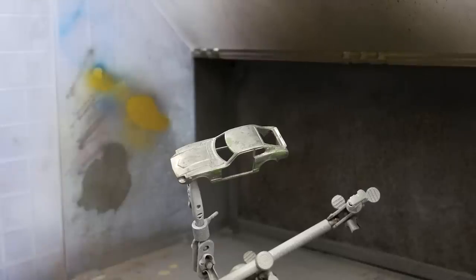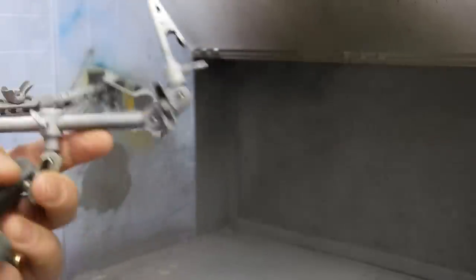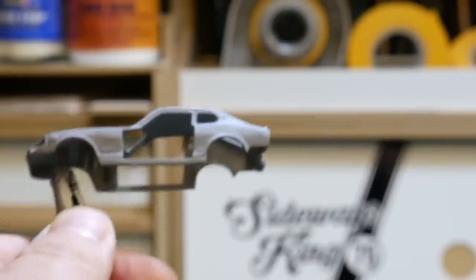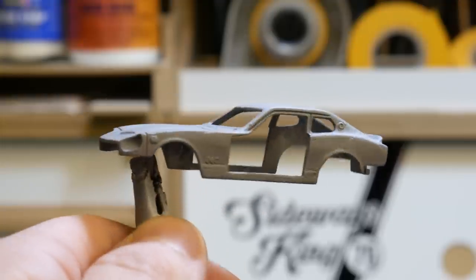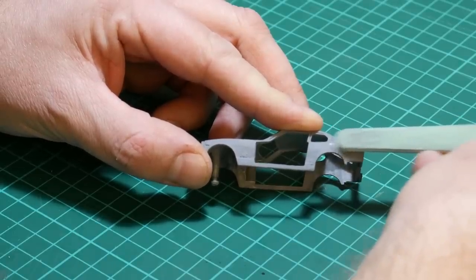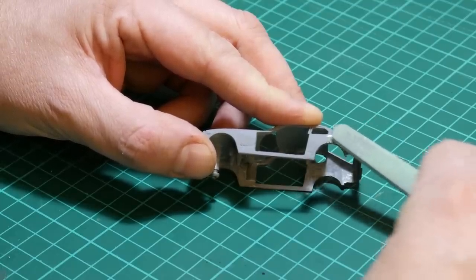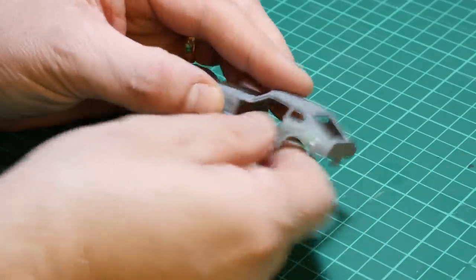Now I'm going to give it a quick primer over that body just to see how good or bad I did. Once you've left it five minutes or so with a few light coats, you get a better picture of what you've actually done. In this case I need a bit more work — it's bulged out in places. That's the whole point of primer really; I can't see how good or bad it is camouflaged with all the different colors and shades. At this stage I can go back, sand it down again, and repeat the process, being careful not to put too much primer on and fill in all the gaps.